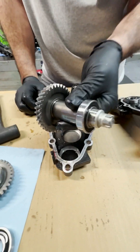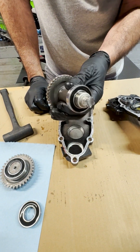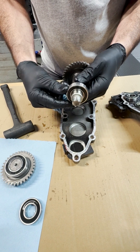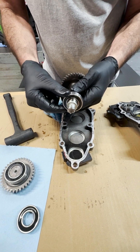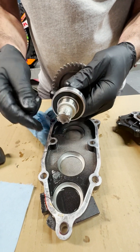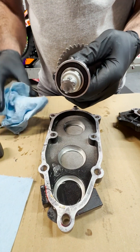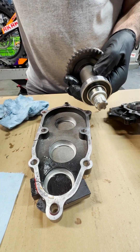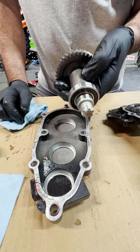When replacing the shaft — you might wonder why not just replace the one broken shaft? Something traumatic happened to it, and that will damage the bearings. If you spin your bearings and feel any little notch, it's going to make noise. I've put them together before thinking a bearing wasn't too bad, and it made a lot of noise. That's why we're replacing all the bearings with the Dirty Bike Bearing and Seal Kit.